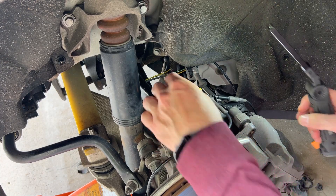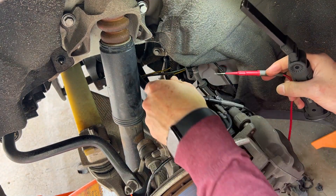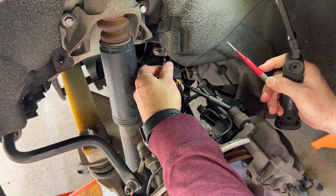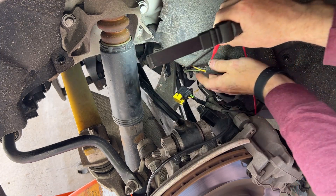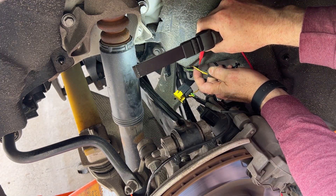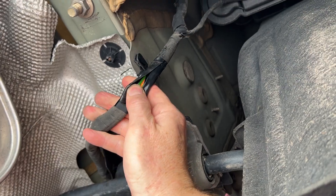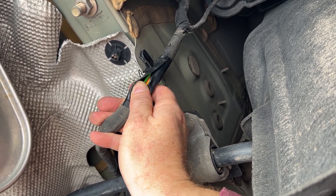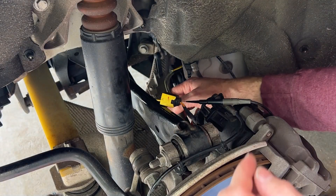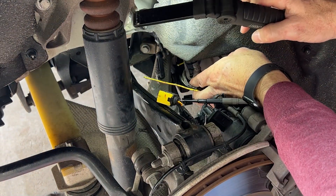I had to do some surgery here. I attached a probe to the backside here, hunting around the wires. If you have a nice sharp-tipped lead you can poke - I went to the end of the rubber piece thinking it's probably good in between the rubber, then just push hard and the needle barely penetrates the rubber. I didn't get a tone there, so that told me I didn't have continuity where it goes up inside the car. I finally got to this part here where I had no continuity and was peeling off the tape, and there was a total break in the wire.